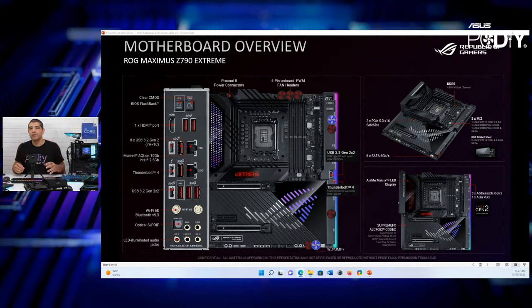Essentially, the way Double Connect works is that two bands can be connected to at the same time. Take for instance 2.4 and the Wi-Fi 6 band connected simultaneously. A scenario where you might leverage this is dedicating gaming to one specific band, and then having a browser or a file download or other connected aspects on the other band. This can help maximize the overall latency performance from a gaming perspective. So this is an exclusive feature on the Extreme as far as the AX411.